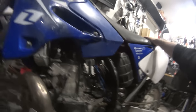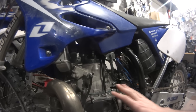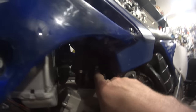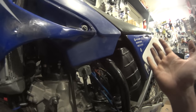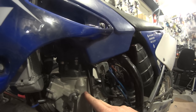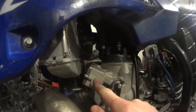And you're not done. Unfortunately, when people say that these are easy to rebuild, there's a lot of work. I prefer to take the engine out to work on it - sometimes you work on the bike directly. The spark plug will have to come out. All these connectors will have to be disconnected from the carburetor so you can take the carb out and clean it. The power valve is over here - you could just soak it in gasoline and that will get it nice and clean.